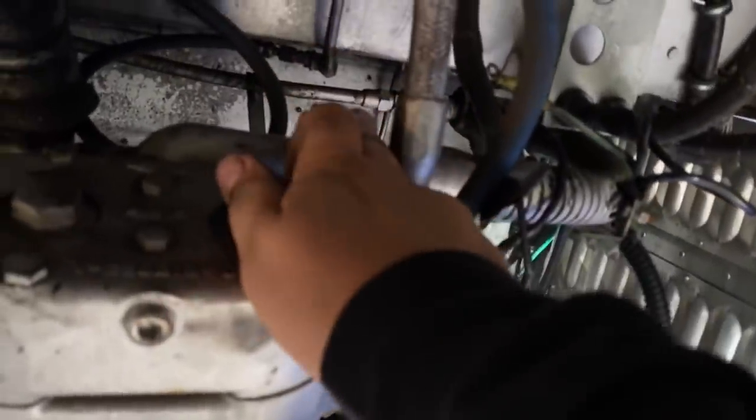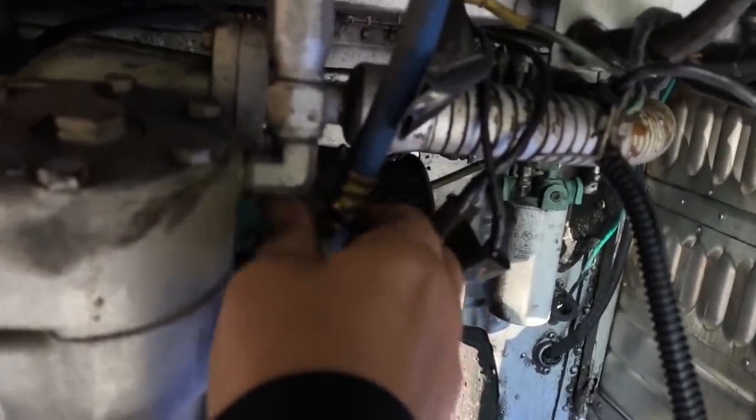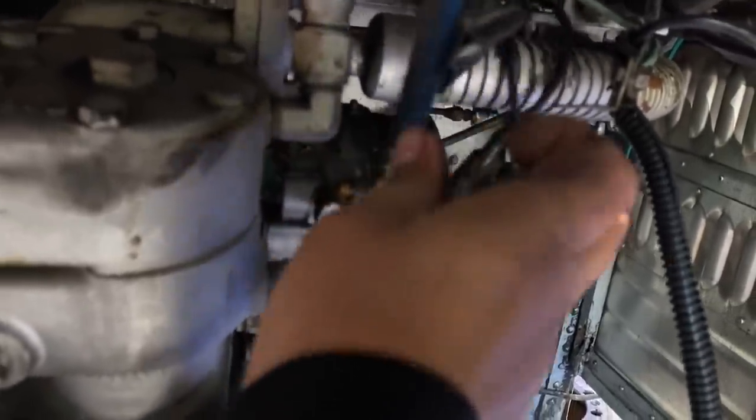The other air compressor line, it's disconnected here, so it'll just be easier to disconnect here on the inline or the outlet there. That's gonna be a different size wrench. Governor. This is the sensing line, so when the tank gets up to a certain pressure, this is where it detects it to shut the air compressor off. Or when to turn it back on when the pressure gets low enough up front. And you adjust the pressure on the bottom of this thing here. If you take that off, you can tighten or loosen it, and it'll raise your, you know, if it cuts off at 110 or 120.